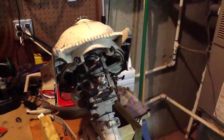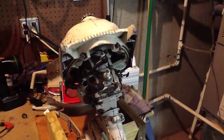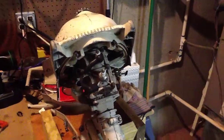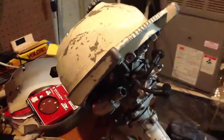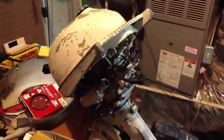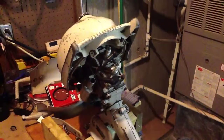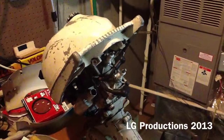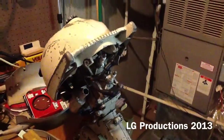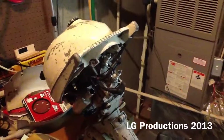That's where this one lies — kind of back to the drawing board, kind of like a glacier, three steps forward, two steps back. Anyway, that's an update on a couple of these projects. Keeping my fingers crossed to see if I can get this going, firing on both cylinders. The magnetos are great — the coils are giving good spark, good fire to them. Just no compression.